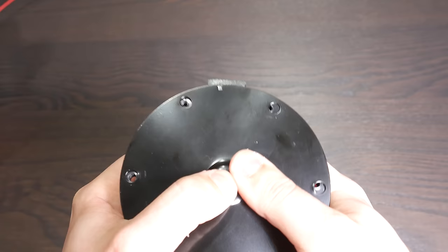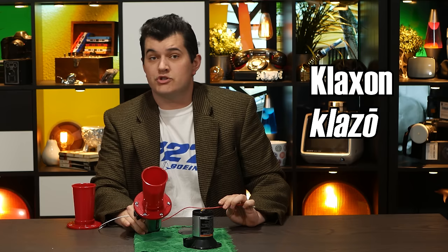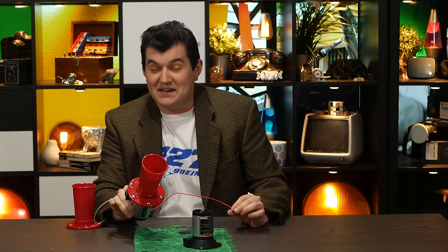Now, I still don't know why exactly the sound is as distinctive as it is. I suspect it has to do with the fact that the diaphragm is flexing rather than simply moving in and out, and this gives it a unique tonality — kinda like the clicking sound of a bottle cap. That click is still there even when the motor turns slowly, but once it reaches a fast enough speed we start to hear the true tone of the horn. Then, as the motor slows after you stop honking, the pitch of the horn's tone falls, but that clicking noise remains distinctive until it stops. At least that's my guess. Layered sounds can be difficult to decipher. This device is sometimes referred to as a klaxon — originally a trade name, coming from the Greek 'klauzo' meaning to shriek. The horns didn't have to be powered by motors; in fact there could be a hand crank, as you may have seen in an old movie.